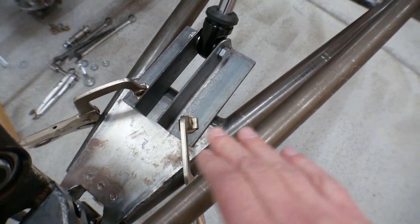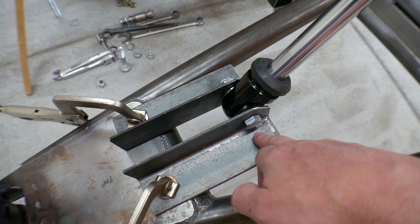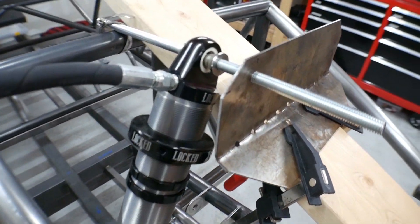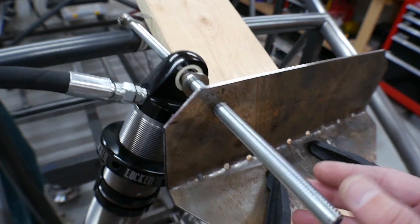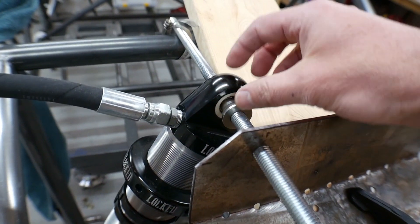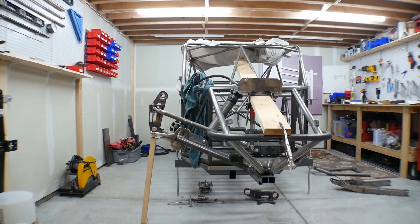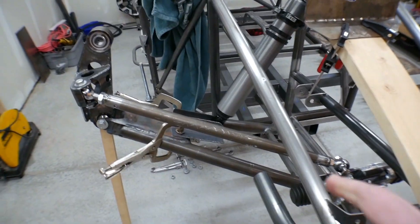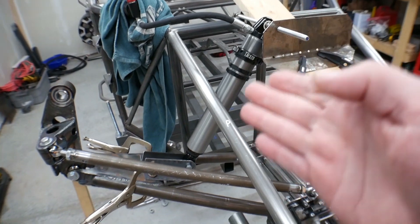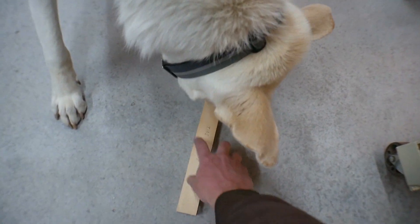With that, I threw in a temporary lower control arm, bolted the shock absorber in place, and clamped in these angle irons so I could move the mounting position back and forth. At the top I also made some temporary mounting points so I could move things around — unclamp and move it to change the elevation, or adjust the pivot point of the upper shock absorber. So at that point, knowing what my full compression was going to be, I could figure out a good starting point for my mounting geometry.